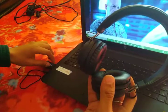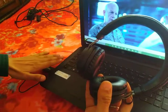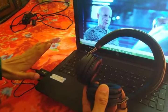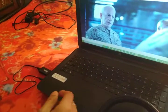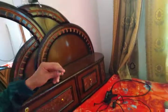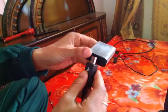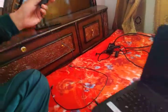Supply the power from some other source which is not your TV or your laptop. If you do this, your humming sound will be removed. The other source can be anything else — you can give the power supply from here, using this adapter, and plug it with this one.